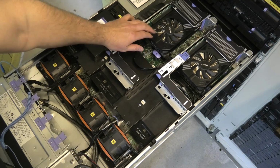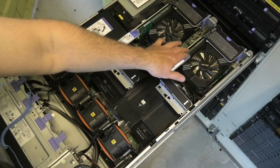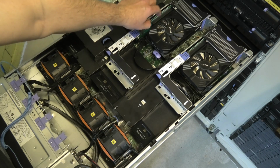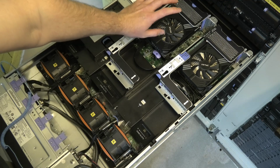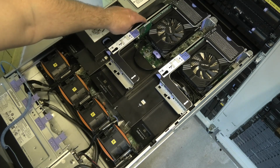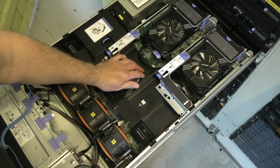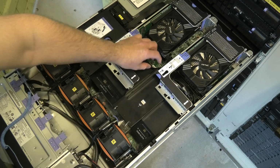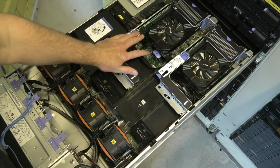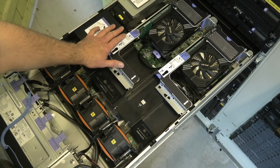Okay, the 2 cards are mounted here. Looks kind of cool, and each have a 6-pin connector here, and they will also be getting some power from the system board. But as for these connectors, I'm doubtful that they're real X16s. They're probably just X8s. So if that's the case, they might only get 25 watts of power coming in that way. So this extra connection here, which should be able to supply about 75 watts, is needed. I'm not sure if it's actually able to supply that wattage through that cable. Now that I've removed the 8 pins and gotten it down to a 6-pin, I might only be able to run one of them, but I do have cables coming in, and they should be landing here sometime next week, I think. But let's try it anyway.